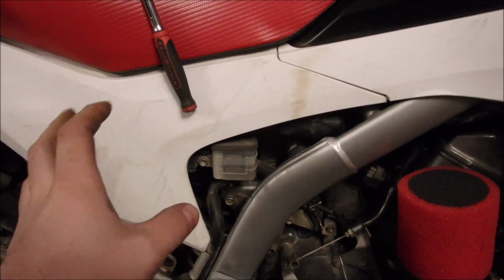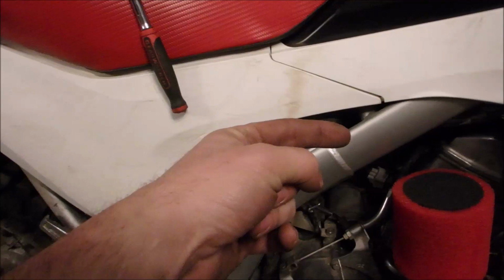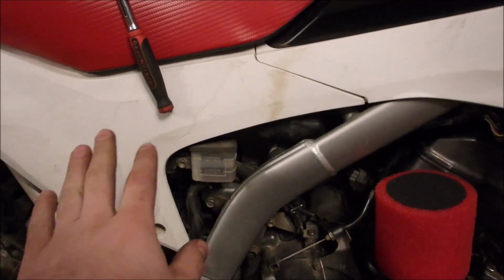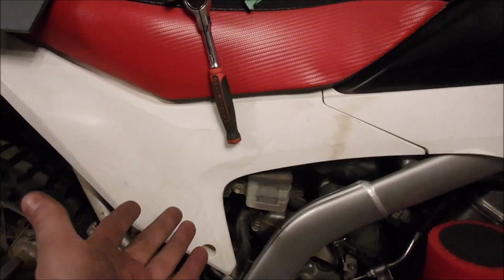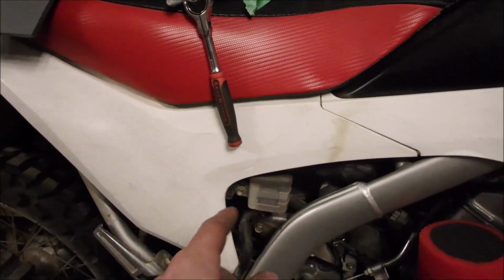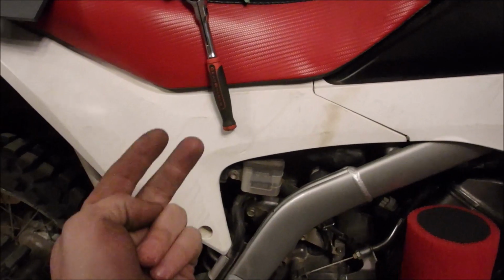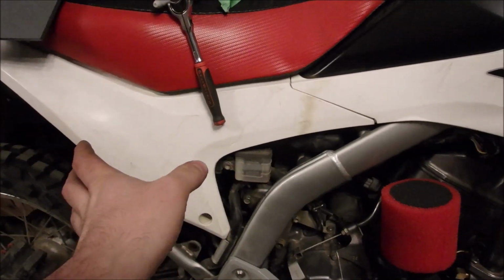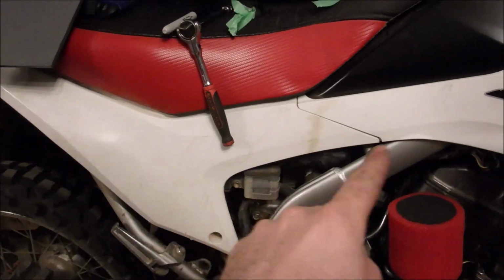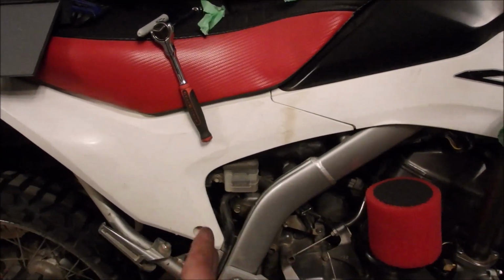and then if I take the factory airbox out, it'll just go into the throttle body. And if I leave the factory airbox in, I think I forgot to mention previously, I'm gonna have to take the snorkel out and plug that. And then there's 2 ports here and 2 ports there that'll have to plug, if I use the factory airbox as a plenum to take some of the pulses of air out.